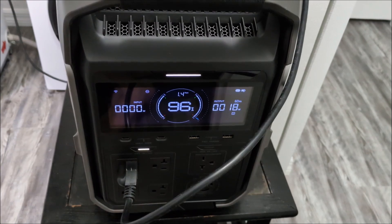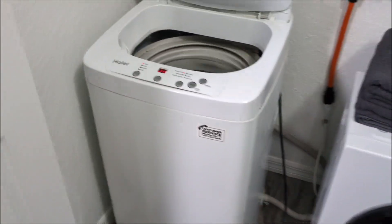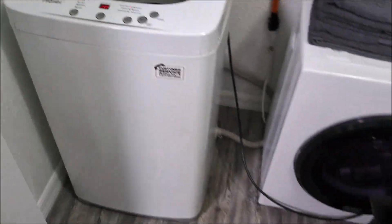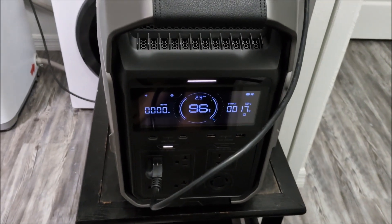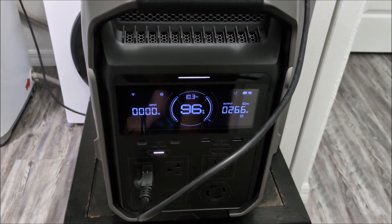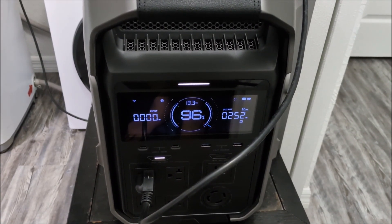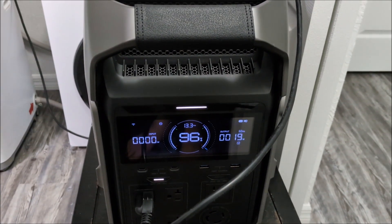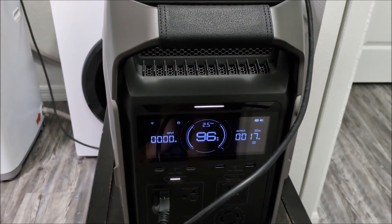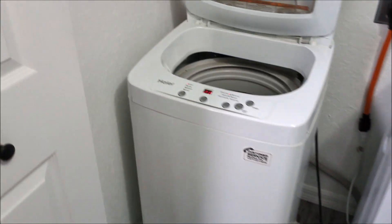It's not actually as bad as I thought it was going to be. With the spin cycle, it kind of spins for a bit, slows down and then starts up again. We saw over 400 watts there for a moment, and the motor steadied to about 250 something. That's probably the most power this thing's going to draw — the spin cycle and the main wash motor.